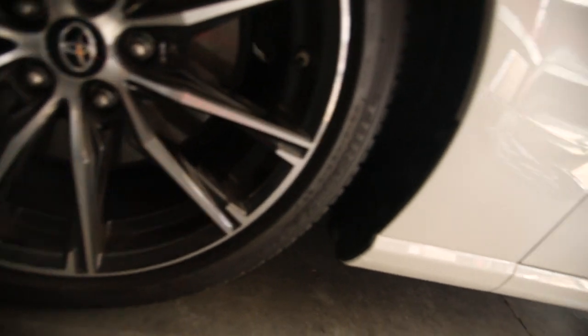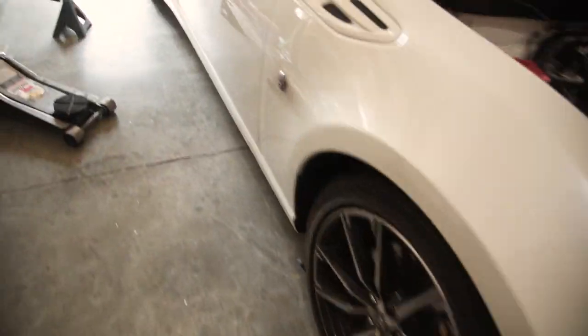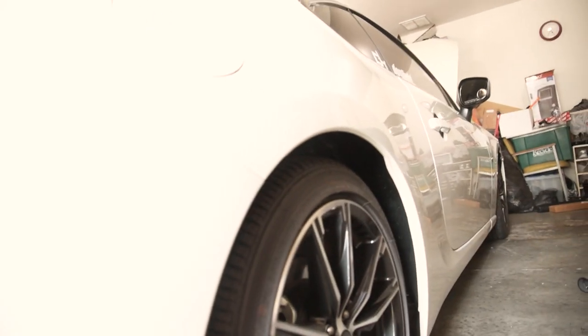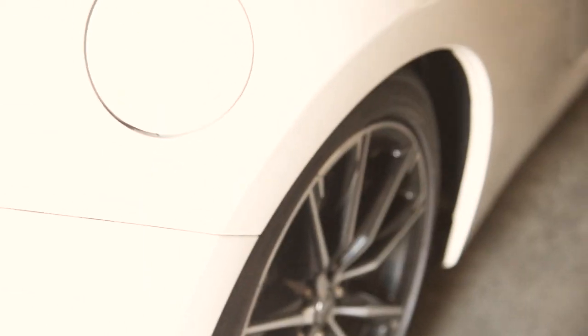It's definitely lower, but I feel like it'll probably go some more - or maybe we should just leave it like this for function purposes. It does look a lot better, but I feel like it's not low enough, so I'm going to adjust and check out the rears. I know these coilovers don't go that low in back - there's a bit of gap there. Also, one side has so much more camber than the other side even though the bolts are set at the same spot. I think I'm just gonna lower it another inch if we can. Ended up doing an inch and a quarter drop in the front - looks a lot better. The rears I actually maxed out. With the 17s there's some gap, but when I get my actual wheels - which will be 18 by 9.5 - should be perfect fitment. I'll probably get some drop LCAs as well to get a little more height, but this is where we're gonna be for a couple months until the new wheels show up.